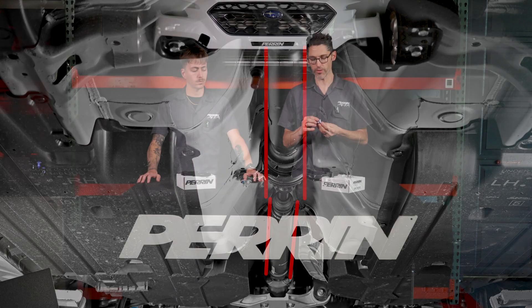One important feature is that our carrier bushings are adjustable, which is how we've stepped up the competition on this part. You can align your driveshaft — something people don't know is that the factory driveshaft is actually not straight from the transmission to the differential; it has a kink right in the middle. Our bushings have an offset hole to allow that to be adjusted. If the driveshaft is straighter under acceleration, it doesn't want to twist off to the side. As for why Subaru didn't align it properly from the factory — it's likely a packaging issue based on where the engine, transmission, and differential line up, possibly also for crash safety to allow the driveshaft to bend on a rear impact.